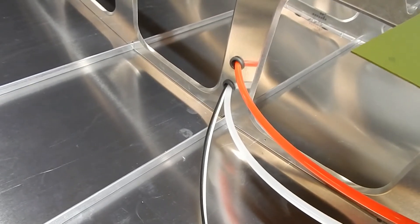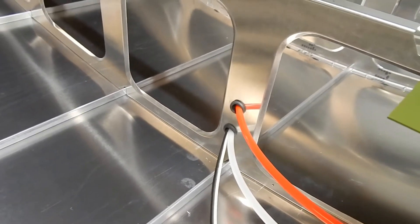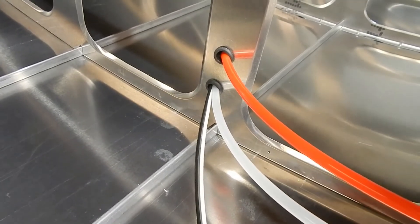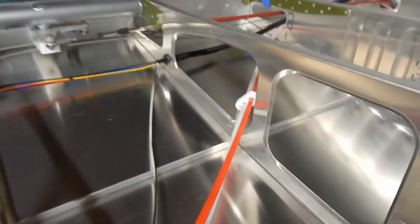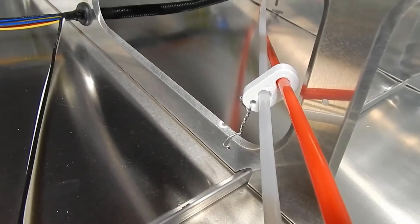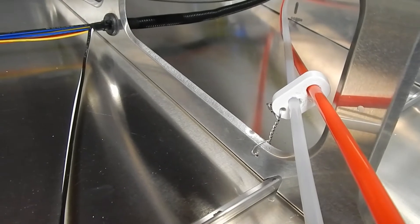For the pitot tube: I had to run an extra pitot tube because the Garmin has both an AOA angle-of-attack port and a ram air port for airspeed. I experimented with three different methods for routing through the ribs. The first used smaller holes with rubber grommets — I didn't like how the rubber moved and might dry out. Then I went with a 5/8-inch hole and plastic clip-in grommets, but I didn't like the 5/8 hole in the rib. On the third rib, I 3D-printed a little plastic harness and wire-tied it with a heavier .40 wire tie, which is closer to what the original instructions suggested.